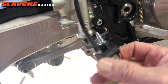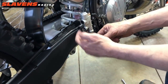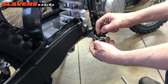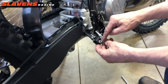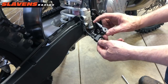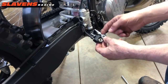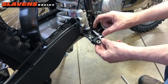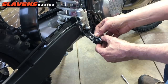And then down here there's just one little adjustment you have to make. Once you've got your cable and everything in position, the cable goes behind the master cylinder here. This piece comes loose — it comes with the nut loose so that you can adjust it. You have to get the distance from this hole to here, make it the same as from this hole here. This has to be matched up to what your brake pedal eyelet was originally, and you're just doing that to get the free play right on your brake pedal. You can use calipers, a tape measure, or just stick the bolt in and lay them side by side to gauge your distance.